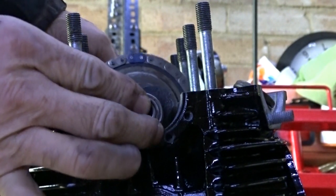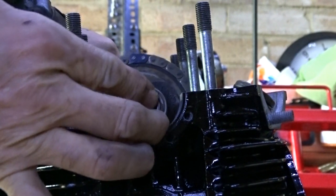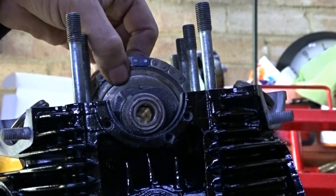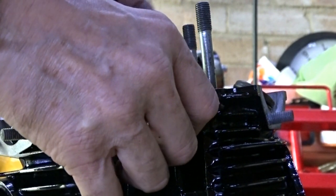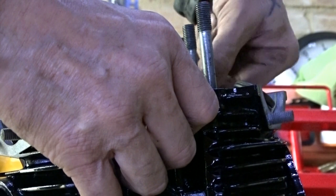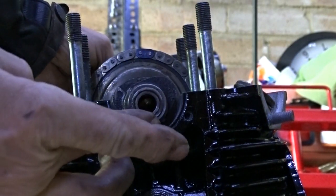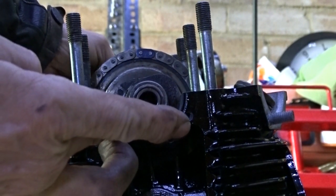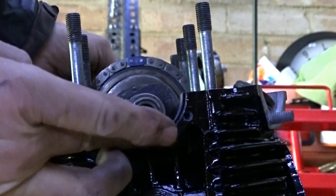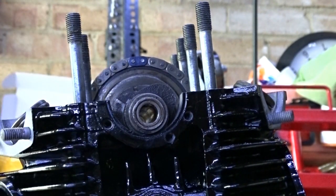The mark at the top is going to roll to the right as you lift the chain up. So what we want to do is take that one notch round. When you lift the chain up now, it is more or less top dead centre, facing straight up. What we're going to do now is put some bearings on, and that'll hold that in place.